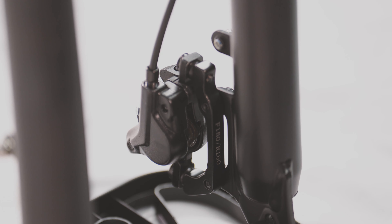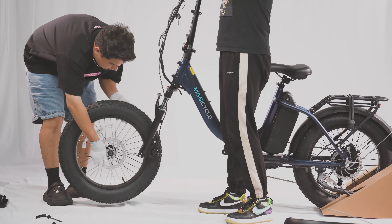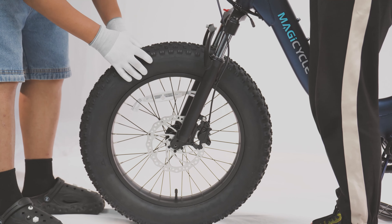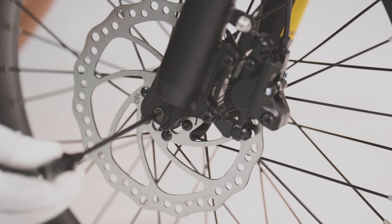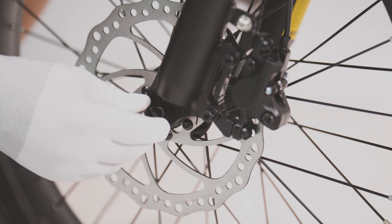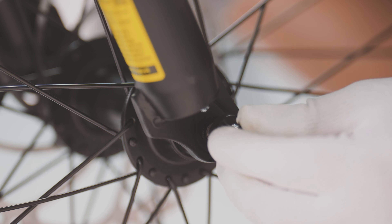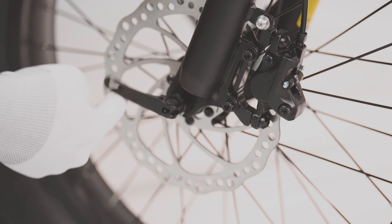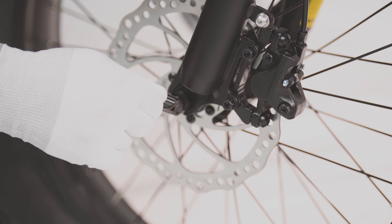Remove the spacer between the brake pads. Have a friend lift and hold the bike sturdy, then slide the rotor between the brake pads and guide the fork onto the wheel. The brake pads need to be properly inserted into the brake caliper. Insert the skewer through the wheel. The smaller end of the cone spring on both sides should be facing into the tire, and the larger side should be facing outside. Hold the thumb nut and spin the lever on the opposite side clockwise. If the lever is too tight to close, then loosen it a circle, then lock it, but make sure it is tight enough.